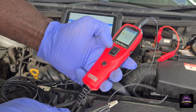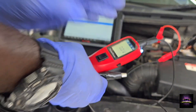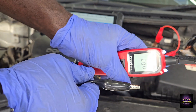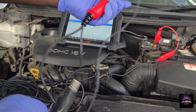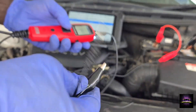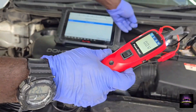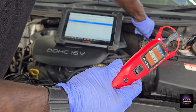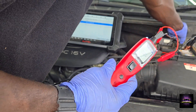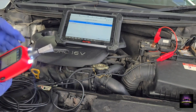There's also a reset button — if you accidentally send power when you shouldn't, you can hold this switch down to reset. This tool is really unique but you have to be careful, especially around electronics. For instance, if I want to see what my voltage is, I'll just touch the battery — I'm getting 12 volts. And if I touch the ground, I can confirm I have a good ground and a 12-volt source coming off the battery.